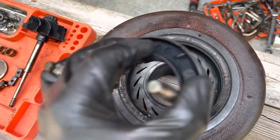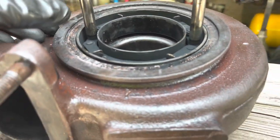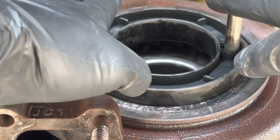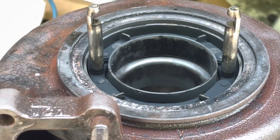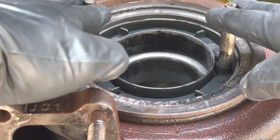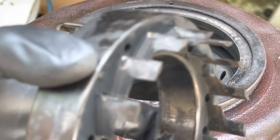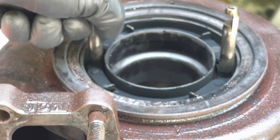Now that the turbo is totally disassembled on the table - about 90% disassembled - we spread out all the parts, do an initial wipe down, and clean everything off with brake cleaner. A lot of these parts are consumable and replaceable, so we'll separate what you replace versus what you keep. This was the problem with the VGT - these vanes here have carbon all over them. When we lift up it gets stuck about right there, getting hung up no matter what position you're in.